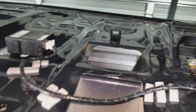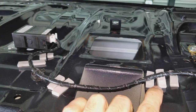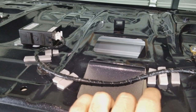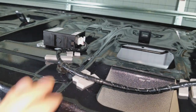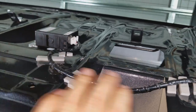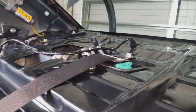All the cables back here — there's actually only two. All I did was take some of that foam tape and put it underneath where the cable goes, so it doesn't have a place to rattle against the metal. Very low-tech, very easy. When you put the cover on it'll just sit here and push the cable down, and it's got no chance to vibrate against the metal. I did this here and on the other side too, anywhere there's a cable.